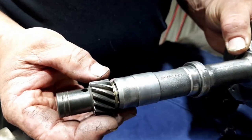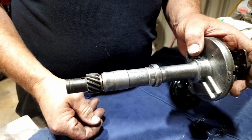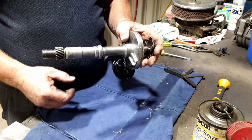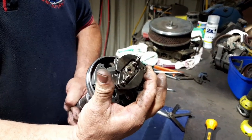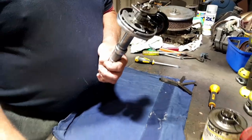So say if we didn't have the right amount of shims, what would happen? It would give you more float up and down, is all that would do. So this end of the shaft here would float up and down more. Which, when it comes to putting the electronic ignition in...